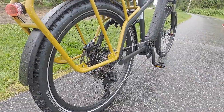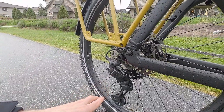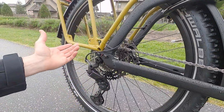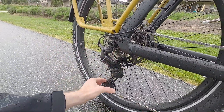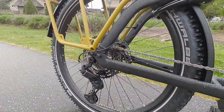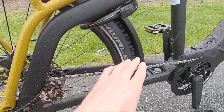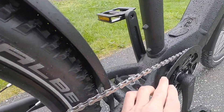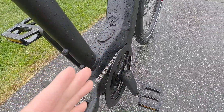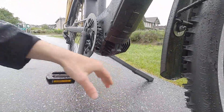This is an 11-speed, 11 to 50 tooth setup, and we've got a Shimano Deore XT derailleur. I really like this derailleur — it has the clutch feature. Right now the clutch is off so it's loose, easier to do rear wheel maintenance. When you tighten it, the chain isn't going to flex as easily, won't bounce around as much, and might not fly off if you're going off-road. I love that they have a matching plastic chain protection sticker to keep the chain from chipping up the frame. We have a narrow-wide steel chainring with an alloy guard. They don't have a full guide on both sides, but the guard is nice and will help prevent damage from a log or rock strike.